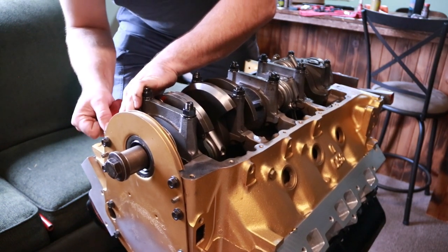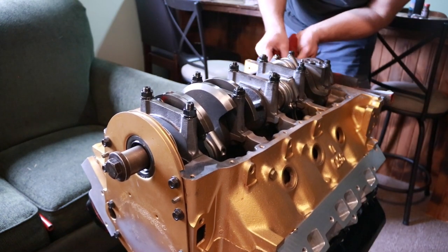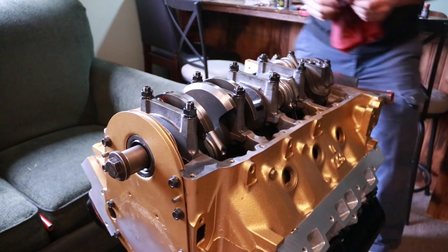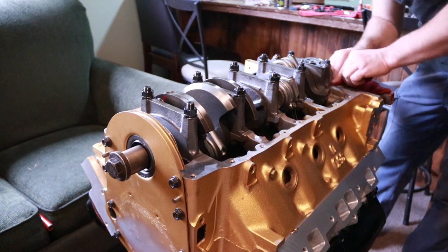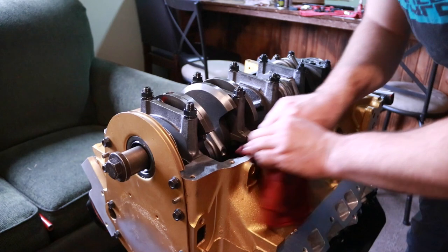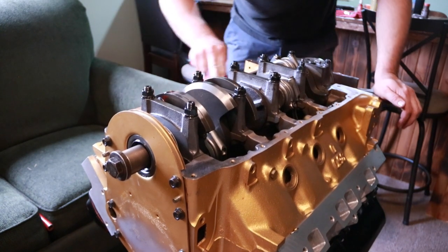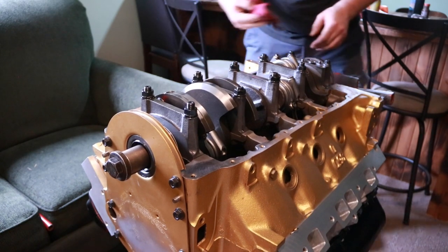You've probably heard me say that so many times now in the last two videos: clean, clean, clean. It's actually that important. I can't remember who put it out, but it was one of the educational videos we were looking at when I was going to school for this stuff. They said the number one killer of a freshly rebuilt engine is dirt and debris that got into it during the assembly process, or was rather not cleaned out. So, everything you can do to make sure that the engine's going to be as clean as possible is worth your time to do.